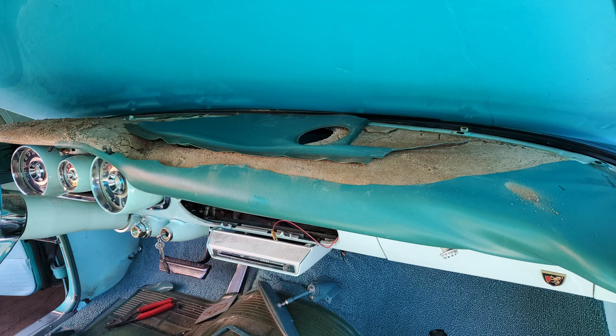If you don't have experience reupholstering this kind of dashboard, in this video I will give you an idea how you can do it. There are three ways. The first way is by removing the whole dashboard out of the car — you have to lower the steering wheel, and if you don't have experience your dash might get stuck in that process. The second way, which is easier, is by removing the windshield, but the customer would have to pay for that. I'm going to show you another way — reupholstering this dashboard without removing the dashboard and without removing the windshield.